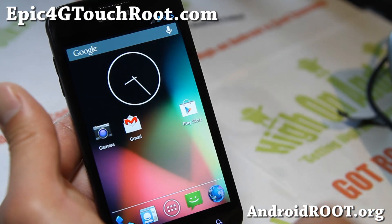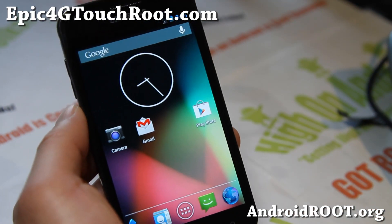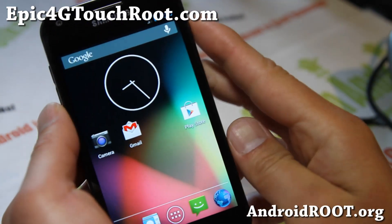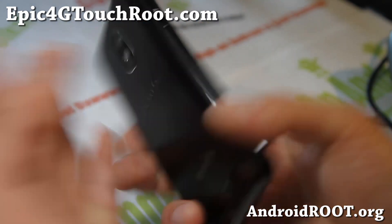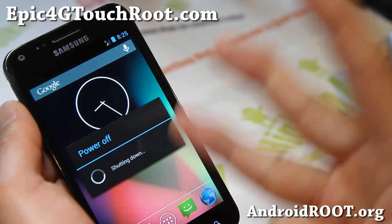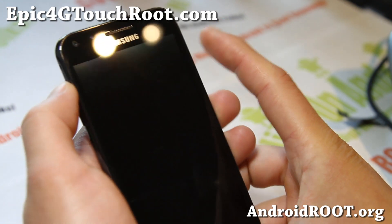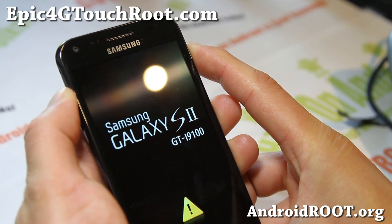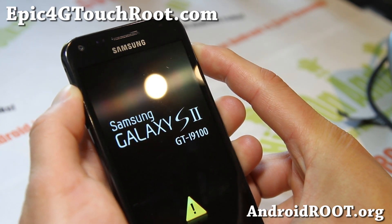Check it out for your Epic 4G Touch, and let me show you how to install it. You'll need three files: the actual ROM file, Google Apps, and a safe kernel. The one I use is a CM9 safe kernel by Chris41G — it works really well. I stick with it because I've bricked my phone a couple of times already on the Epic 4G Touch. This is a very brickable phone. Copy the three files — I'll have the links on my website in the description — then power off and hit volume up and power. I'm assuming you have a rooted phone with some kind of recovery; if not, go ahead and root it first.